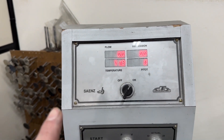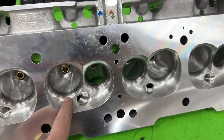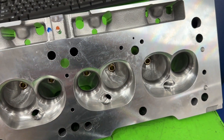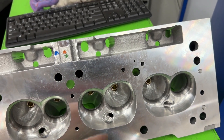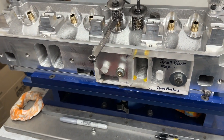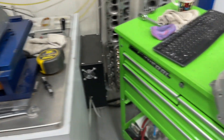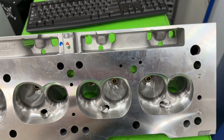What you're going to see is it's going to drop — it will go from 306, 309 down to 300. My hand won't be in the way blocking it; you'll see my hand will be out of the way. It will never come back up to that 306-309 range, because something with this wing and the way it affects airflow — it's kind of like an air manipulation device. It jacks up the numbers and looks really good until you have the smallest change in airspeed or port flow. Then the air gets disrupted, it loses where it's attached, and you'll see the flow drop.